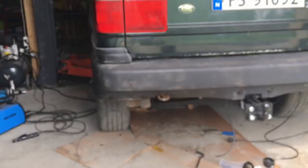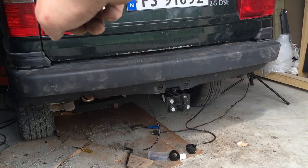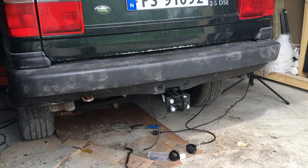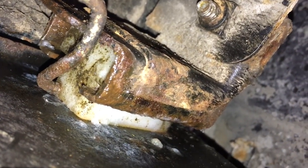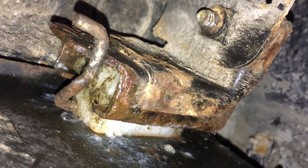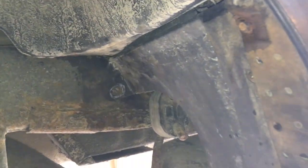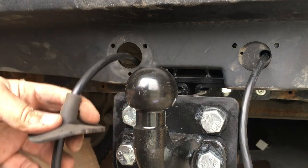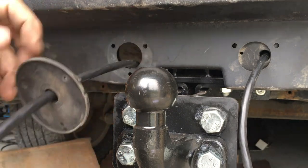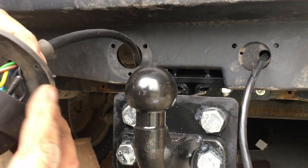Make sure your sides are even and in the clips on both sides, then you can insert the two bolts going down to hold the fender in place and turn the clips inside the fender down and into the grooves to secure them. You can see one of the bumper clips on the front towards the wheel where it's been clicked in place — that metal rod has been pushed upwards. Make sure those are downwards when you put the bumper in, then push those rods up to lock the bumper in place.